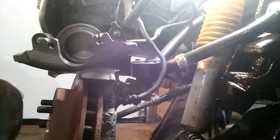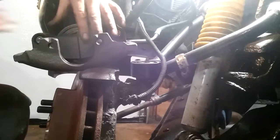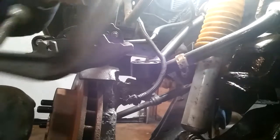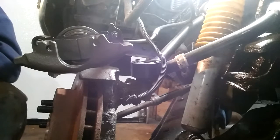The inner pad has a clip that goes beside the piston, and the piston has to be pressed all the way back. The way to do that is use the old pad and a big C-clamp and just clamp it all the way back, and have the master cylinder cap loose or off so you can get the pressure pushed back.